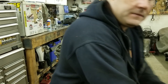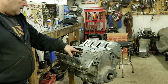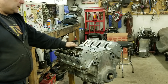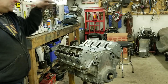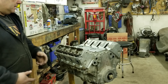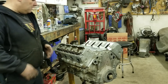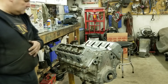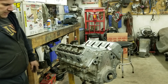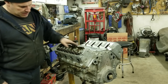So that's the heads on - now they just need to be torqued. I'm going to check pushrod length. I have some 7.4 pushrods - I ended up putting a little bit longer ones in my car after I had it running, so I have a set of BTR chromoly ones. I'll end up putting those in - most people say 7.4 is good so I'll just double check them, clean the rockers and put them on. The engine is basically ready to go in except for the oil pan, which is next, then painting the engine and getting it back in.